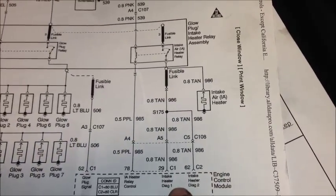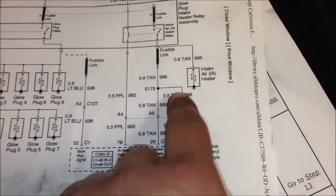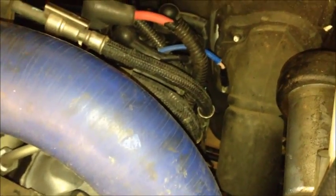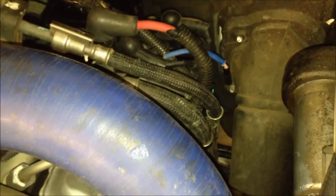The actual problem with mine was this tan wire right here, as you can see, in this connector right down here — that is how it was. Looking at our wiring diagram, that tan wire is the intake heater diagnostic port. So you can see tan, tan. Basically there was no connection to the PCM, which was causing the check engine light. The intake air heater was properly working, but the PCM couldn't see it working, so it flagged a check engine light. My repair was simple — just plug the intake air heater wire back in. Clear the codes and the intake air heater is working fine. No further diagnostics needed.